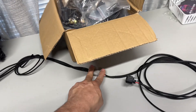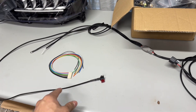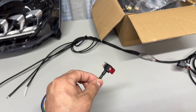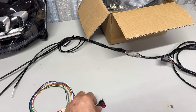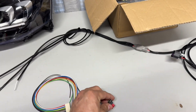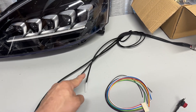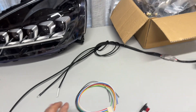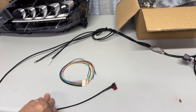I made it a two-piece so that if you want to disconnect it you can. Run this to the inside — you're going to need to put this on a fuse, okay? Anything that turns on when you turn the key will turn on the sensor. So this is going to be power, simple as that. Then we have ground — anywhere in the chassis it doesn't matter — and then we have signal.